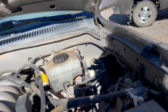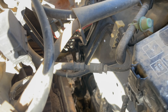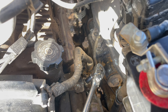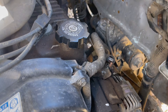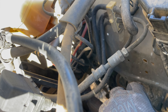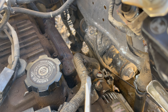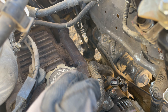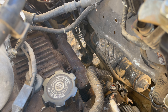That's the plastic housing pulled off — that's a 10-millimeter bolt, so pull that out. I had to kind of wrestle with that wiring harness, but there's a little lip down there that you can get a screwdriver on to push it while your thumb works the little tab. Kind of a pain, but unplug that, unscrew that from there, and we're good to go.